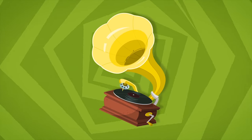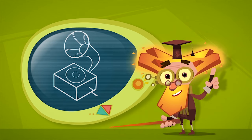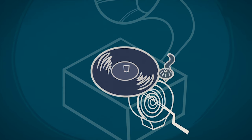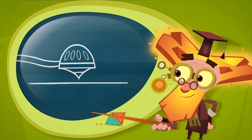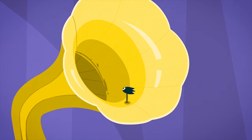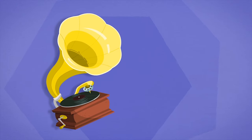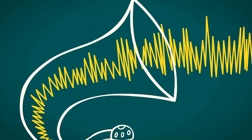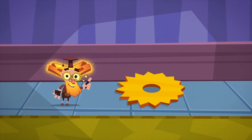A gramophone is an old appliance made for playing back sound recorded onto records. To turn on a gramophone, you need to turn the handle to wind up its spring. The spring makes the record spin. Then a needle is placed on top of the record, and as it moves through the groove, it shakes a little, which makes a diaphragm — a sort of mini drum skin — start to vibrate. The big horn of the gramophone then makes the sound louder and we hear a voice or music. The most amazing thing is that a gramophone doesn't have an electric motor or any electronics — you don't need electricity. That's because a gramophone is an entirely mechanical wonder.